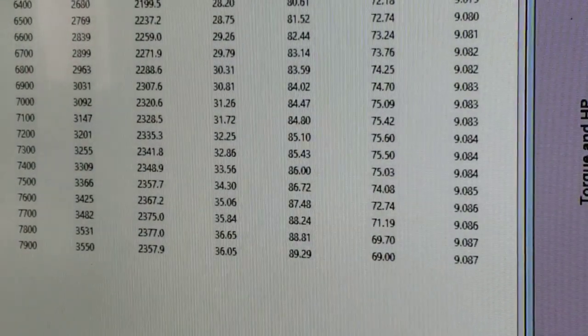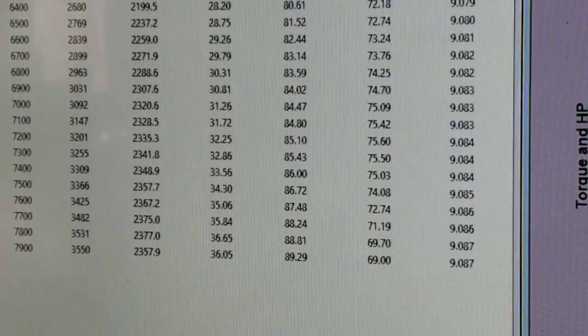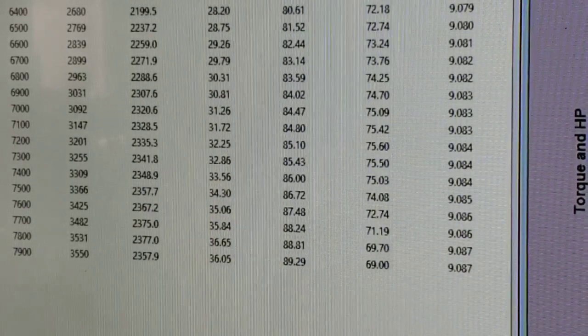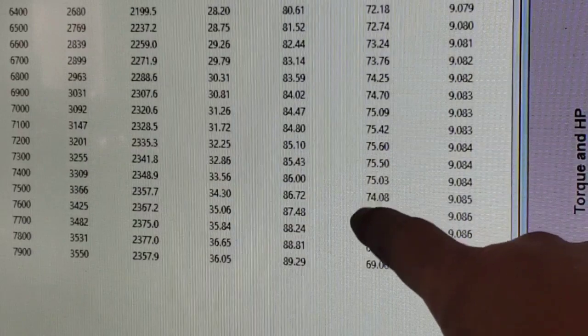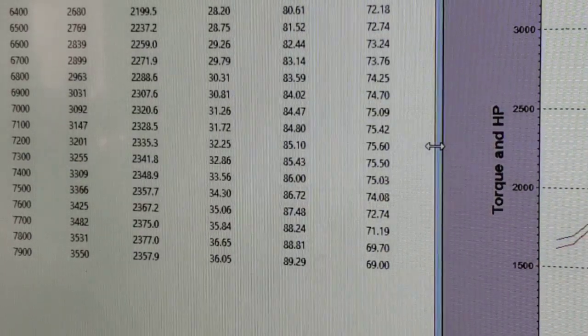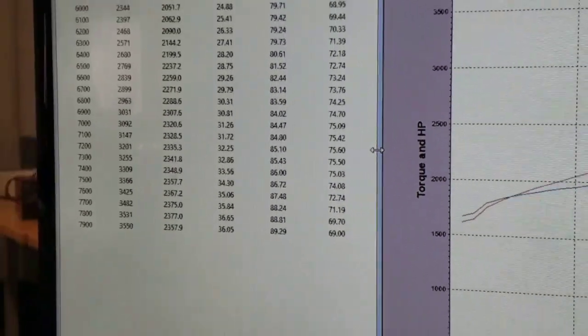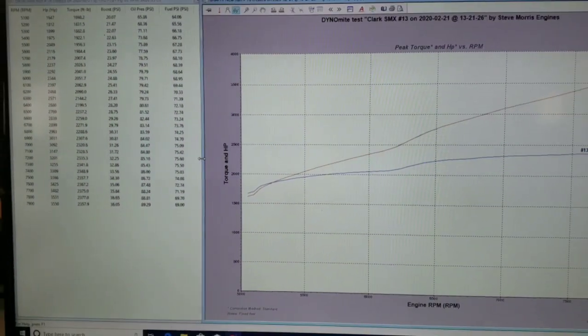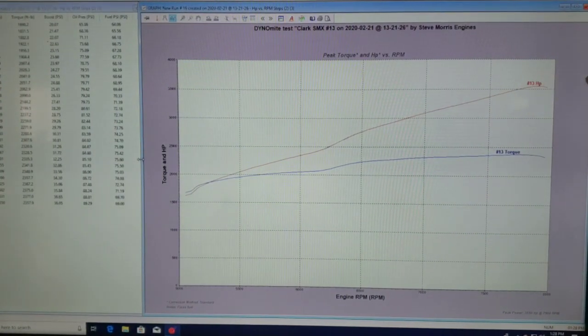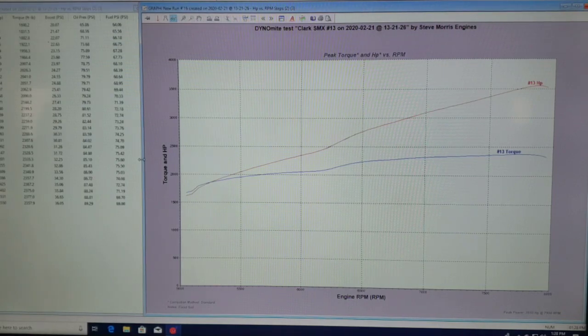How's that look? I pulled back just short, so you got 35.50 at 36 pounds of boost. I'm running a little bit out of fuel pump right there, so I got to go fix that. I don't have the dyno O2 hooked up, I'm only using the EFI. That was at 35 pounds of boost on race gas, and that's pretty good. I'm pretty happy with that. It still climbs out here if I want to run it out there, but we'll run it down the track like that.